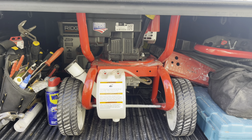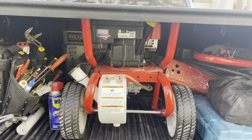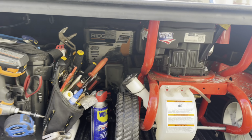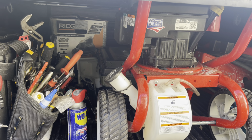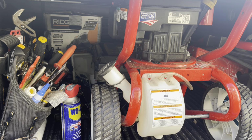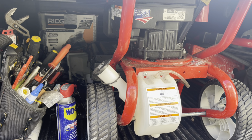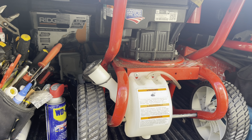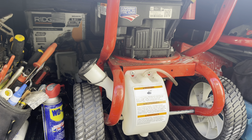Alright guys, so that's how you fix the pressure washer. If you have a problem, it's really hard starting and everything, the only key is to clean up the filter, the carburetor, all the lines in the gas tank, everything. Just need to clean them. Needle, take it off, remove it, clean it with gasoline, clean it, and then you'll be fine.